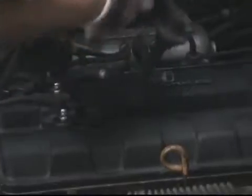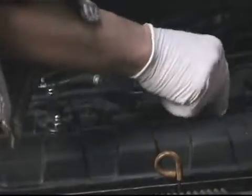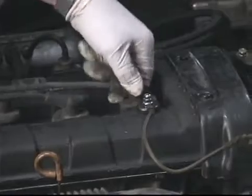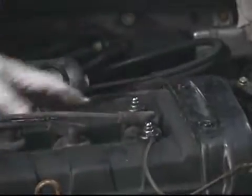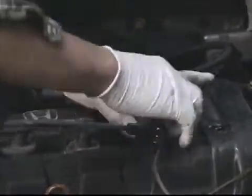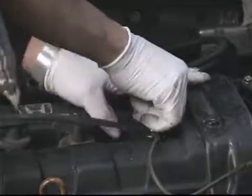Almost impossible to mix up the plug wires. You just go by length. And I just lay them out in their order, one by one. And once you get everything in there, set up correctly, then just gradually wiggle and push them down. And they should snap. There's a cap and a locking ring on the very top, and that will seal them from the upper side and keep the contaminants out.